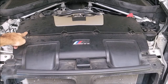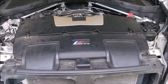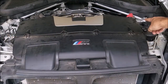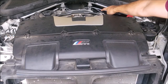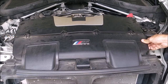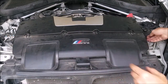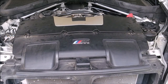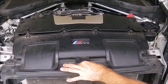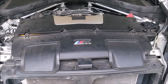To get to our air filters there are four T25 torx screws hidden underneath these little bumps — I'm going to back those out. Underneath here on either side you have a metal post similar to what held the engine cover down, and this piece is pressed down onto it so you're going to have to pop it up. Same on this side. With those popped up we should be able to get the air filters out. You can use a pry bar but there's no reason to — you can do it by hand.